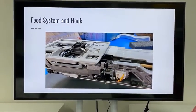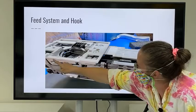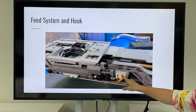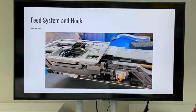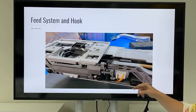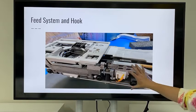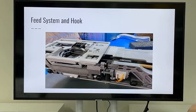The motor belt runs the upper shaft, and the timing belt coordinates with the lower shaft. This is a picture of a feed system — we often think of just the feed dogs on the outside, but the feed system on this machine includes an upper horseshoe piece around the hook, a lower horseshoe piece, forks, a feed step motor, a box slide, and gears. On machines with integrated dual feed, there's also linkage going up to a walking foot — mostly on Husqvarna machines, though some Viking models have it too. The feed system is bigger than just your feed dogs.